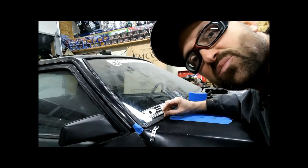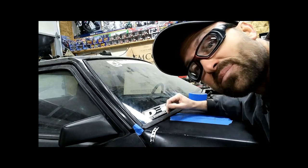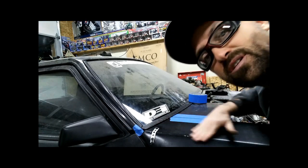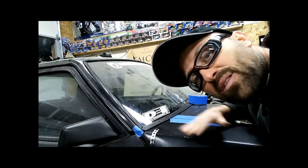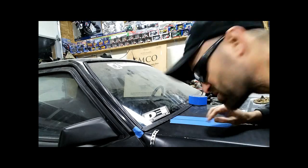It's probably about a 2 millimeter gap between these two. That's really not so bad. I can at least build up the surface and then blend this out a little bit here. So scuff the surface in. I can probably put down 1 layer of fiberglass matting, fiberglass it on, and then just sand it till I feel like it's really where it should be.